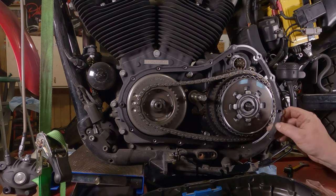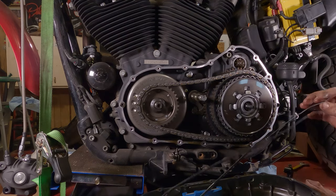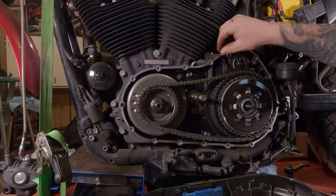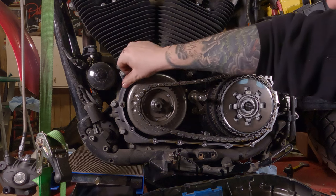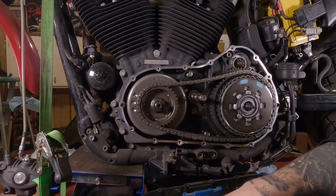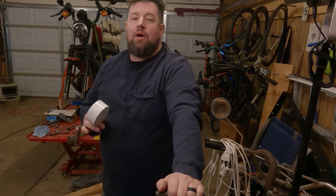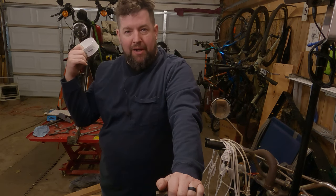If your intent was just to replace this gasket, you should be able to peel the old one off. Some say these are reusable — this has got 20,000 miles on it, get another one, don't be cheap. Your friends will make fun of you because your bike leaks all the time and you'll have to hear the Harley jokes. What you can do is put some degreaser or engine cleaner on a rag and scrub all this down really good. Any old gasket pieces, parts, or residue need to come off, and the same with the outer cover, so it'll seal up nice and tight and won't leak on you.